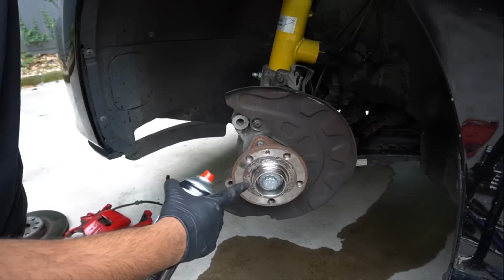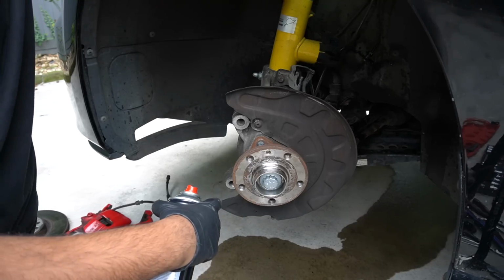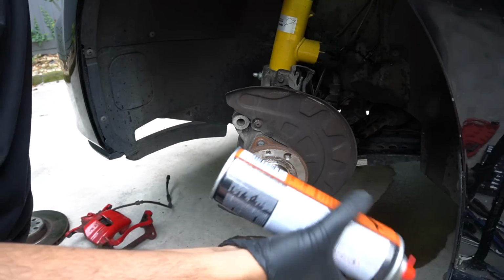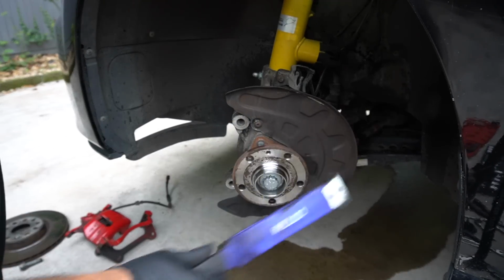Stock discs off. Right, so because we've got a new wheel bearing here, this is all relatively fresh. There's only a bit of surface corrosion. It's nothing too crazy, but I can guarantee you if it's not a new wheel bearing, it ain't gonna look like this. Still use a ton of brake cleaner, so clean up all the mounting points that you're going to be using. I mean, normally I'll pull out one of these to clean the surface.